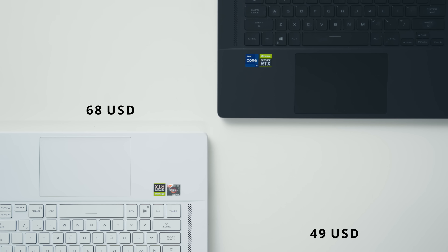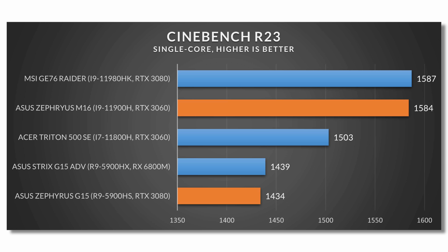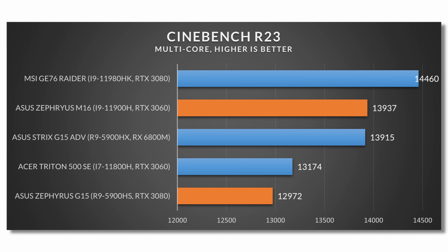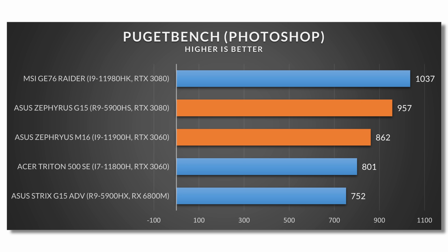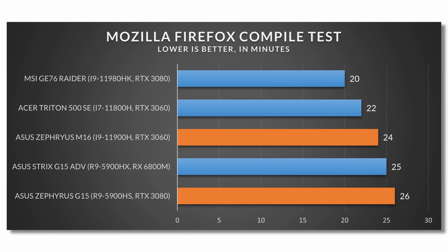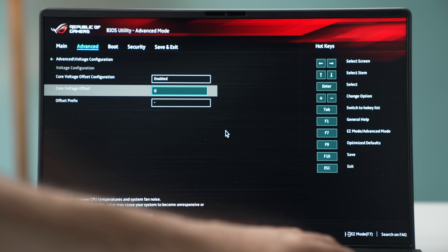The second major difference is performance. The G15 uses an AMD CPU — the Ryzen 9 5900HS — while the M16 exclusively uses Intel, specifically the i9-11900H. In synthetic benchmarks, the Intel processor wins every time with faster single-core clock speeds, better for 1080p gaming, and slightly better multi-core performance. However, in Adobe Premiere Pro, Intel's QuickSync working in unison with NVENC gives better results — though that's more Adobe's poor optimization than an AMD problem. For compiling code, it's slightly faster in short bursts on the M16. You can also go into the BIOS and undervolt the Intel processor by 80mV to reduce temps slightly and get slightly better performance.